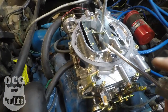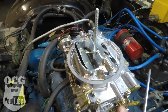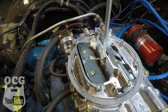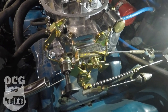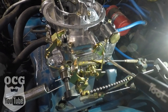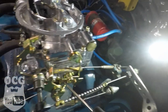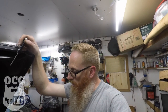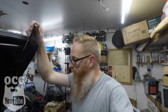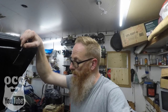When I went to the other side to try and adjust the choke — which is controlled by this piece right here — as you can see the choke is open too far, so we're going to have to adjust it. But before we go too far, I've come to the realization that the throttle cable is at its maximum adjustment, so we've got to get that moved forward to take up that gap. Until we do that we're going to be stuck with a high idle. I'm going to see what's available for adjustable throttle cables, buy one, and get that on there. In the meantime we're done here for tonight.